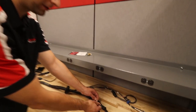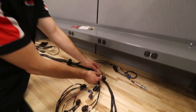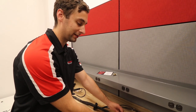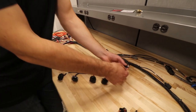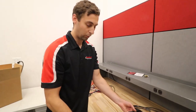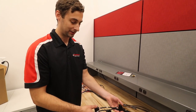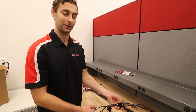Next is the engine coolant temp sensor, labeled ECT in the harness. It connects to the factory 07K coolant temp sensor at the rear coolant flange on the back of the engine. Then we have five ignition coil connectors labeled IGN 1 through 5, with IGN 1 being farthest from the timing cover on the 07K. If you have a turbo application with these wires near your manifold, it is suggested you add a heat shield to protect them.